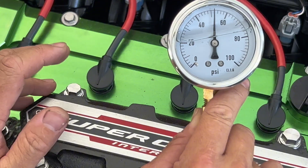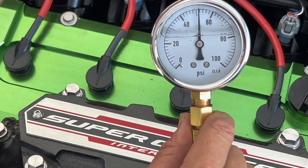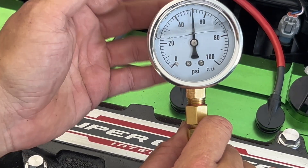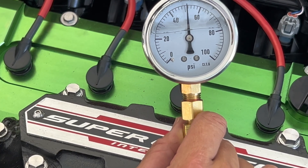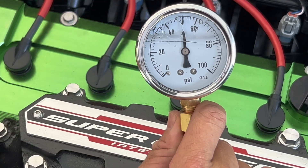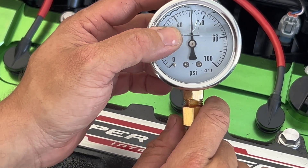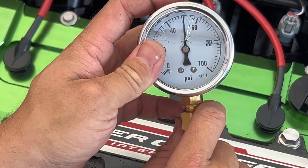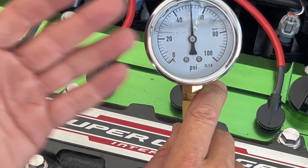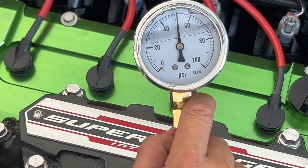This will drop down over time, so don't worry — it's not going to hold that pressure overnight. My analysis would be that my fuel pump is functioning properly. But if you're having issues, you want to get out on the water with this gauge. Run your ski hard, and when you start having that stuttering or loss of RPM, look at this gauge. If the gauge is showing solid fuel pressure, you can rule out the pump as your issue. But if you have a blocked filter, a blocked internal screen, or any type of fuel pump related issues, you will see a decrease in pressure. Or if you put your key in and the pressure doesn't go up fully, that could be a problem with the internals of the fuel pump assembly or the pump itself. This is an incredible diagnostic tool.